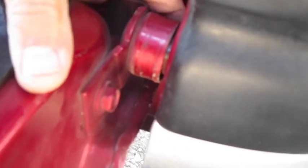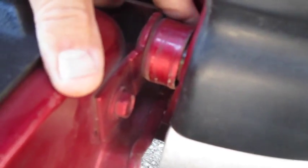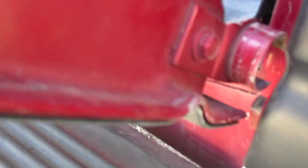You're wondering why this was so quick and so easy to do? Well, the design of this slotted ring where it mounts, it's got a slot on the back side. And once you align that slot with this stationary slide, it comes right out. Look at the side of it. Shoot the ring on that side. Look right here. And that slide goes right in here. See that?